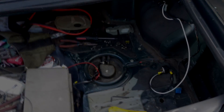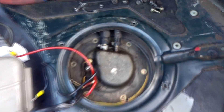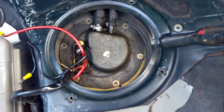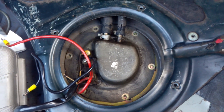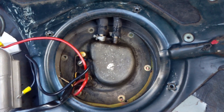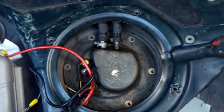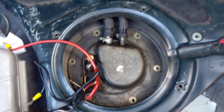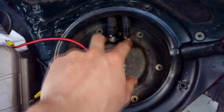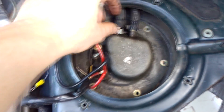I've removed all the coverings on the fuel pump and disconnected all the wiring. Now, chances are there's going to be a fair amount of dirt built up on the top, and you don't want that going inside your fuel tank. Best thing is to give it a good cleanup with a rag and some compressed air to blow everything out of the way so it doesn't fall straight into your fuel tank when you remove the pump.